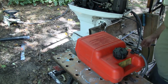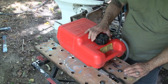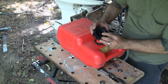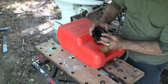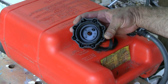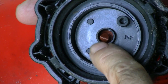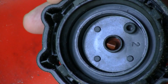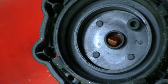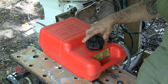The gas tank is probably one of the key causes of rough running. The first thing you want to look at in the fuel system is the vent — it should be open. A lot of times these vents fail. The vent has a little one-way silicone flapper valve, and it should let air in but not let anything escape back out. They do fail a lot of times for reasons unbeknownst to me.